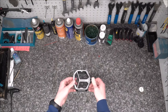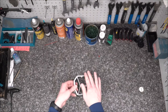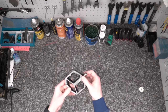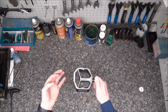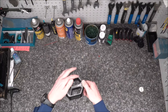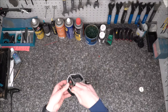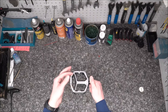Upgrade your pedals. The pedals that come with pretty much any mountain bike — if they even come with pedals — are mediocre at best: a plastic pedal with very little grip. Going to a full metal pedal with a fully sealed bearing is a big improvement. Some have a lock nut to seal in the bearing, others have a high quality rubber seal. The bearing spin quality gets better, and the traction points become metal. Some have sharp-edged or adjustable pins that can be removed and replaced with longer or shorter ones, and different brands come with washers so you can make them taller depending on your preference.